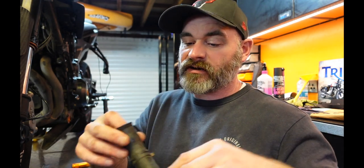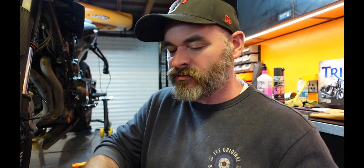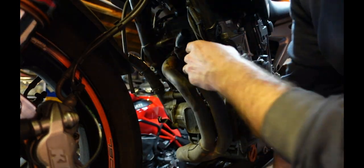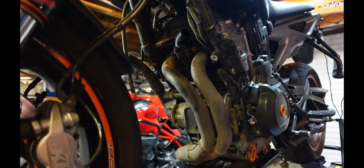I've got the hose off and it's still very rubbery - there don't appear to be any splits or anything. It's not started deteriorating; it's still a rubber hose with rubberiness to it. I'm just going to check there's no damage on the bike side of it, and if there isn't I'm going to have my fingers crossed that it just needs a new jubilee clip. There is a tiny bit of corrosion on this fitting as well, so I'm just going to spray a little bit of ACF-50 on it.